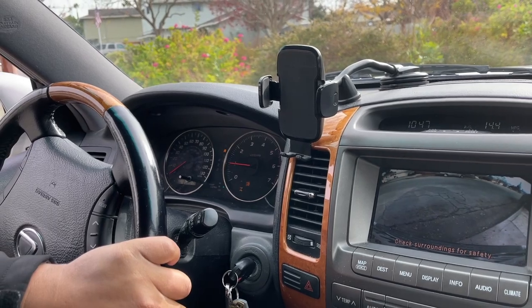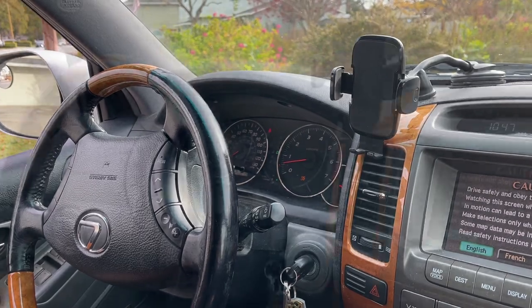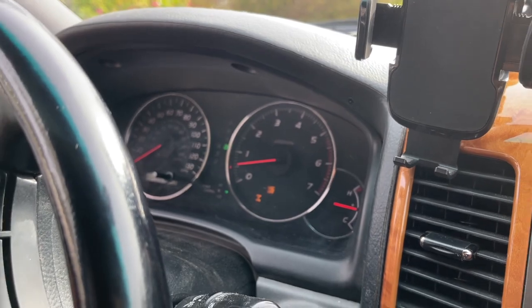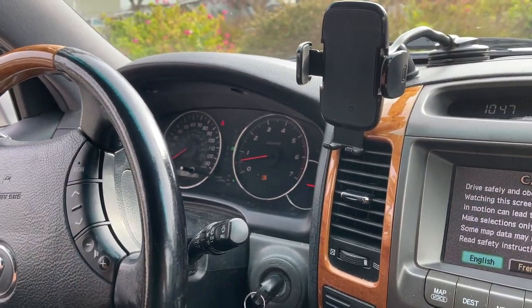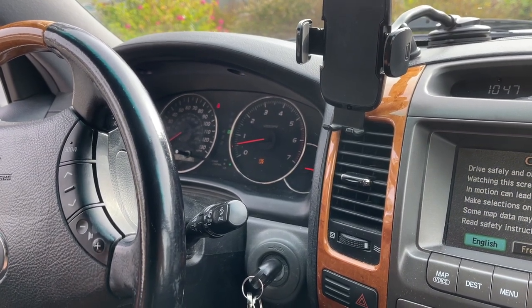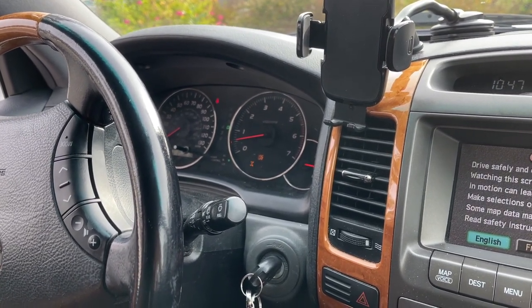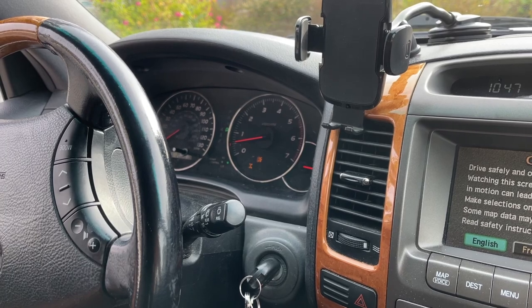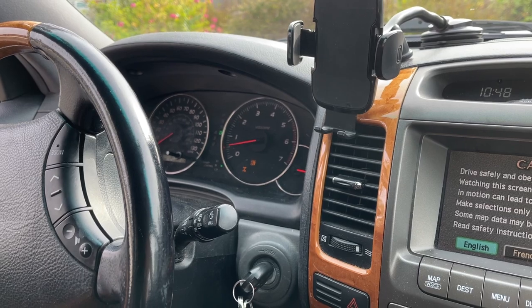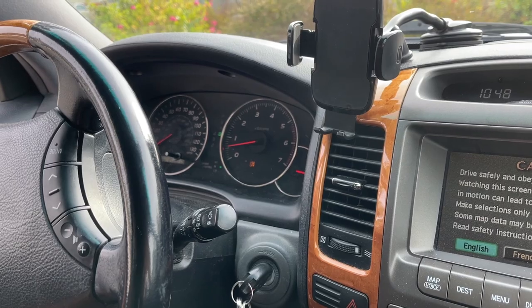Do you feel any binding? Feels like a lot of resistance. With the wheel cranked and the center diff lock engaged but the display still blinking, it sort of feels like it is locking, but we're not getting the light to go solid to indicate that it is fully locked. It might be a problem with the actuator — there's a little micro switch in there, and maybe the micro switch is bad and it's not letting the four-wheel drive ECU know that the center diff is locked. That's enough for this test.